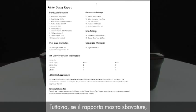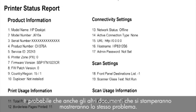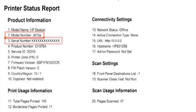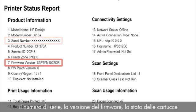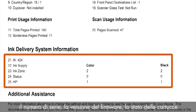However, if the printer report shows smearing, lines, or some other error, other documents you print will likely have the same problem. The printer report can also give you valuable information on model number, serial number, firmware version, cartridge status, and other helpful information for troubleshooting.